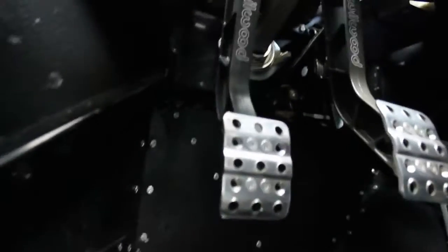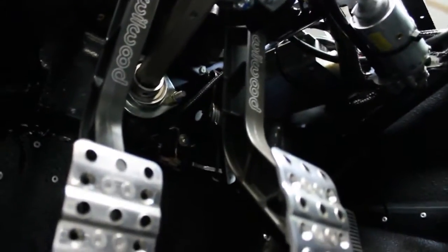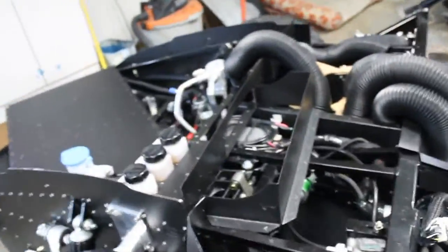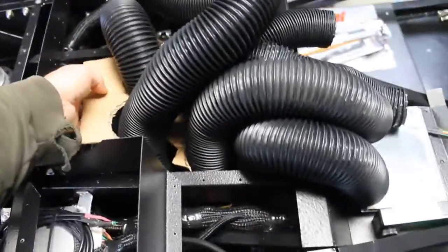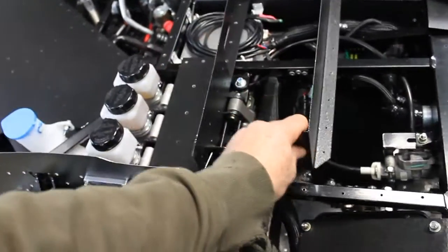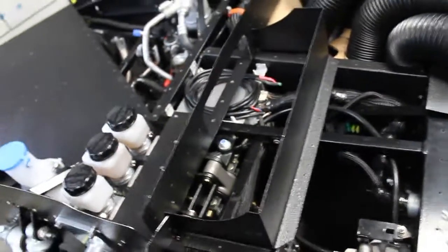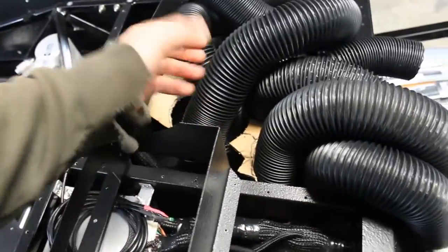There are the switches — one for the brake and one for the clutch when it's hooked up. I just used some epoxy to glue them in place. I got the wide-open throttle switch wired up and ready to roll. I've been lining up where I want to put the hole in that top plate, mocking up a piece of cardboard. I found out I need to change that, taking into account where this piece is which covers the windshield wiper assembly — that also affects where these hoses are and how they come across.